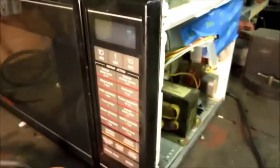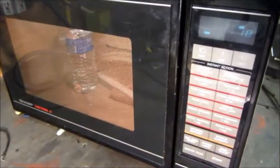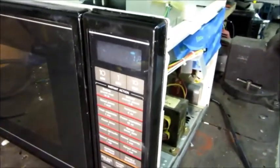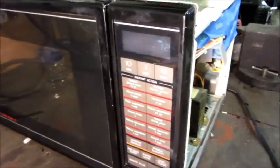Now just get the cover back on and return it to my parents. The classic function test is to put a fluorescent tube inside and see what happens — I don't have the turntable so it's sitting on a block of wood. If the microwave is working, the fluorescent tube should light up, and as you can see there's plenty of light. That's a great way to instantly confirm it's putting out microwave energy without waiting to heat food or water. There's also a schematic on the inside of the cover to help with troubleshooting, and you can tell how simple this oven is just by looking at it.